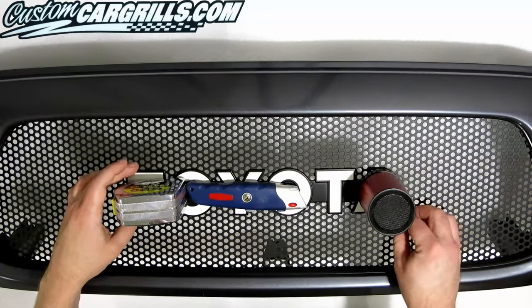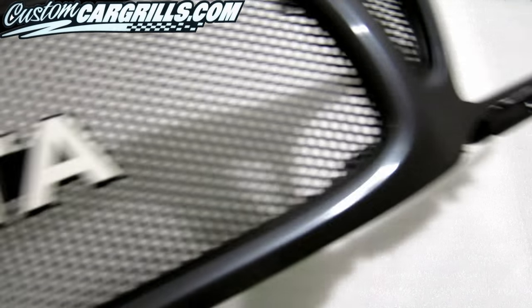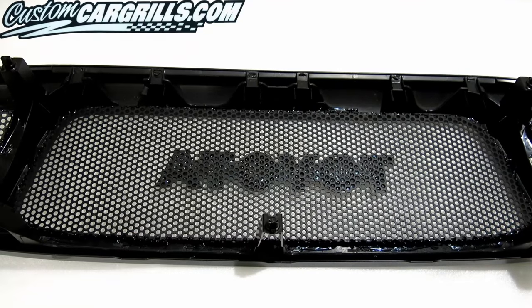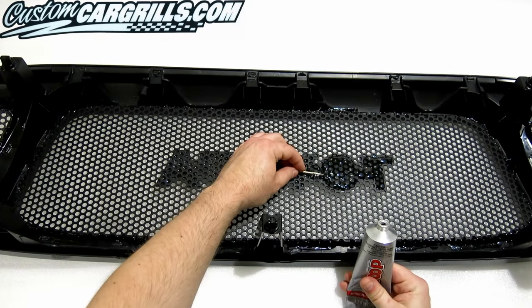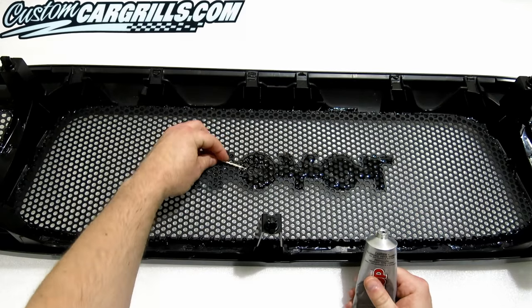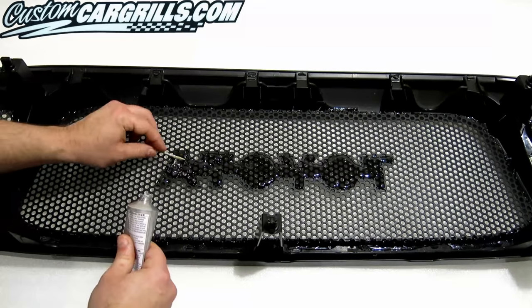After it's cured, the weights can be removed. The emblem's looking really good, but I'd like to add another layer of goop to the back of it. The grill just needs to be flipped around for the second application and we'll be all set. For the second application of the adhesive, I'm laying the goop on the mesh near the center of each letter. It's important not to use too much or have it spill over the edge. Once this cures, this emblem should be solidly in place. Some areas like the Y or A are a little tricky because of the points, so I'll be extra careful on those areas.